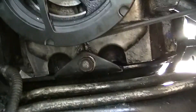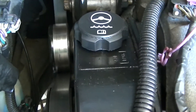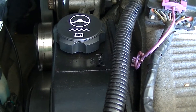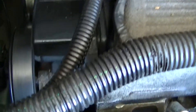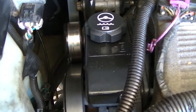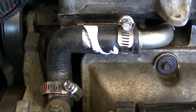Moving up top, you pesky little power steering pump — I had a problem. I bought a brand new power steering pump and was never able to get it to bleed. So last night I went to my local scrapyard, found a Rendezvous of a similar era with a 3400-era power steering pump, cleaned it up, and bled it. It had its own issues but bled almost right away just doing the old back-and-forth steering wheel trick with the power off.